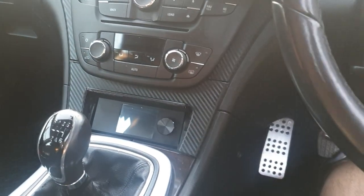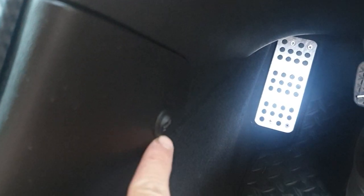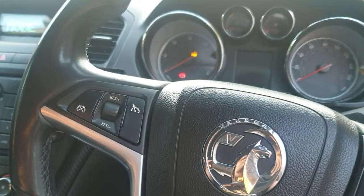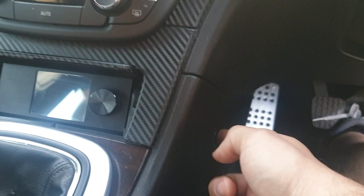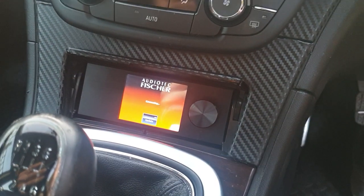My ignition is now off, no key in the car. I flip the switch - one of the positions puts it on the remote. The middle position means it's not powering anything, so even if I put the ignition on the car turns on but the DSP doesn't come on because it's not connected to anything.